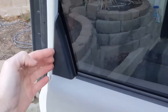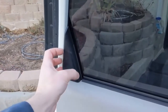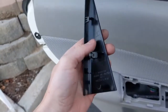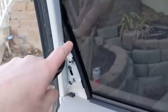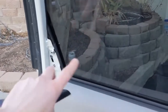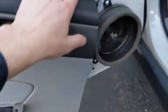Now that the panel's loose, take this piece off — it pulls from this side and then out. There's a little hook on the back side, so it's best to pull angled like that and then straight out. You can see that piece has a center clip but also a lip that hooks it in at the top and side — if you just pull straight out, those can break, but pulling at an angle first prevents that. Once that piece is off, it's just a matter of pulling the panel up and then out. Now we have access to the speaker.